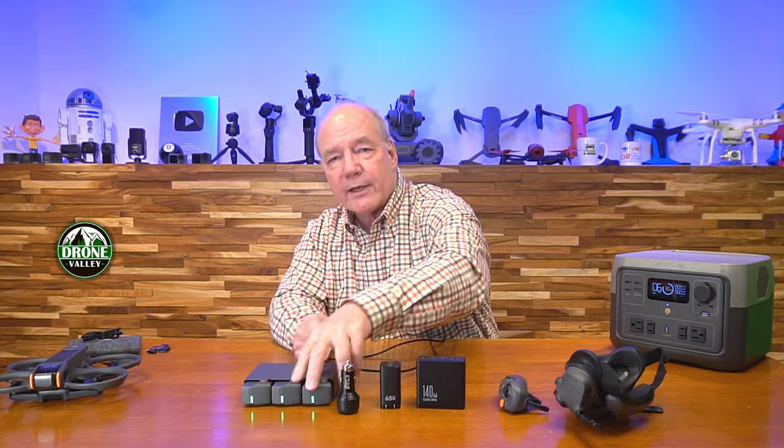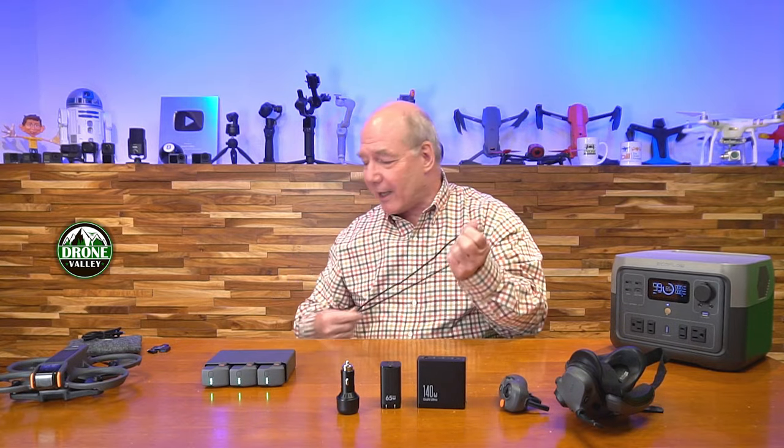And again, I'm not trying to sell you a charger. I really just wanted to educate you on what you should be looking for. So at the end of the day, you want to find a charger that has at least one port that's 65 watts or better. You want it to be PD as well, because that power delivery standard will recognize the fact that the battery's at a certain level, and it'll adjust the voltage and current to quickly and safely charge it. If you can find a charger that's 100 watts or 140 watts with multiple ports, you can charge multiple devices at the same time.